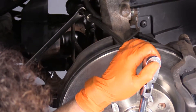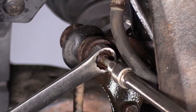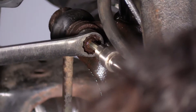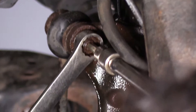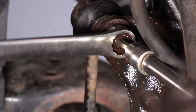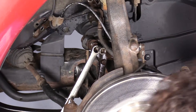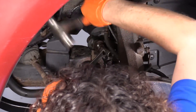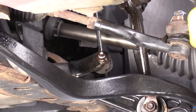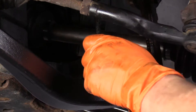With that there and holding that, going the opposite way, then I'm going to pull down. I'm going to take a hammer to that, tap that off. Now I'm going to spray the bottom part of the link, let that soak, get my 14-millimeter and my 5-millimeter Allen head socket. I'm going to break the nut free first with a 14-millimeter socket.